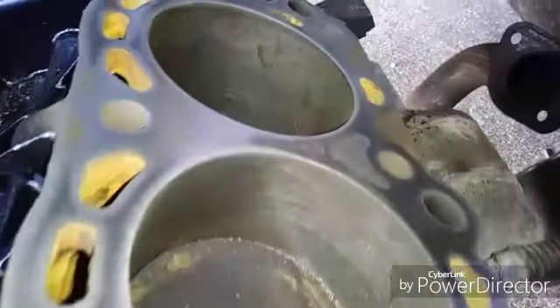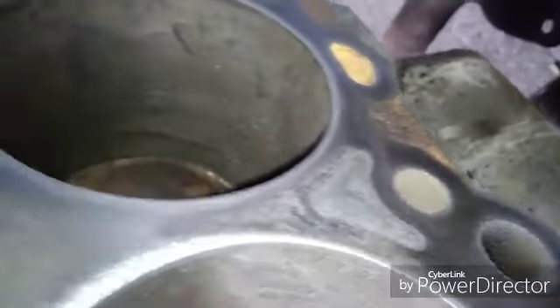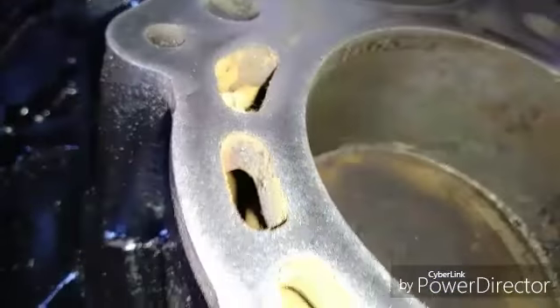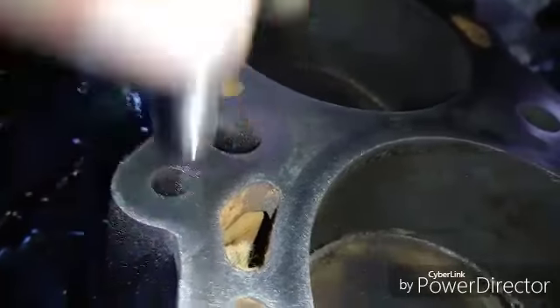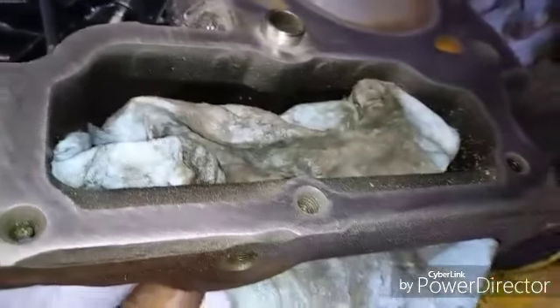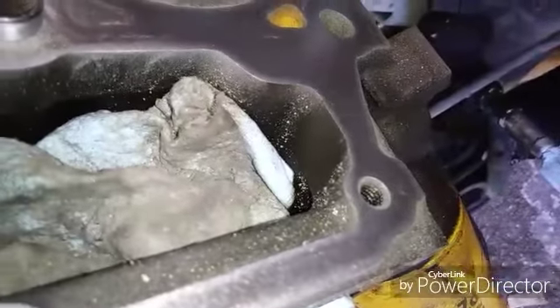Okay, nicely cleaned up - pretty good. You got a couple little light rust spots right here but that's nothing a little hand sanding can't do. You're gonna have to get some more sandpaper and just get right around these corners. Same thing here - get this light stuff up. Make sure you protect this hole right here; I just used my bolt, got all the way around it, and when I got close to being done I went around it, didn't go over it. Make sure you protect your big hole right here because you don't want too much stuff to fall down in there.